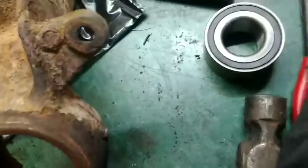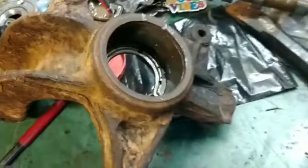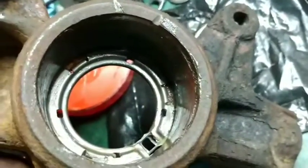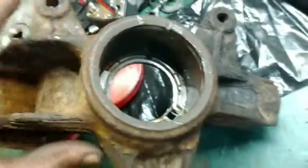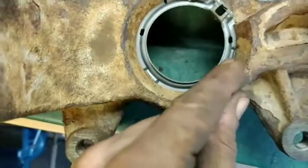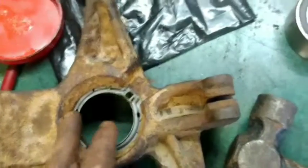There's a new cage in at the bottom of the hole there. It's got three spring clips that hold it in place. I've also lightly greased that so it'll help the bearing going in. On the other side, here, is where the bearing will slide in. So you've got spring clips — one there, one there, one there. You can't just change this unless you're changing the bearing. If you've got a problem, you need to change that.